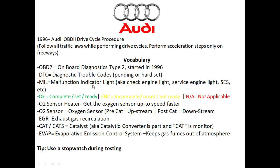MIL stands for malfunction indicator light, also known as the check engine light or service engine light. When you're using an OBD2 reader you're going to see the display — it may read 'OK,' which is the same exact thing as complete, set, and ready. When you come across 'INC,' this means that monitor is incomplete and not ready. 'N/A' basically means that monitor is not applicable to your vehicle, so go ahead and skip it.